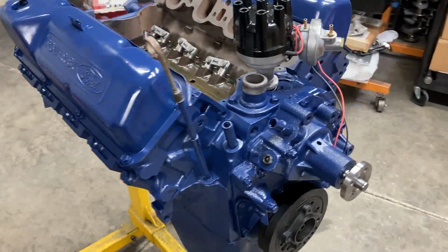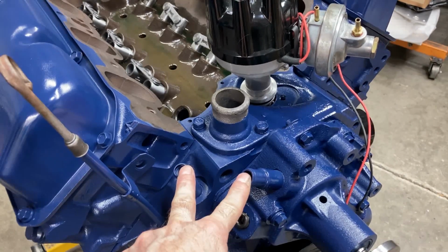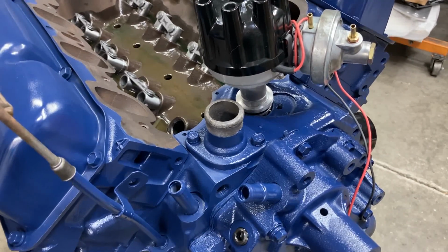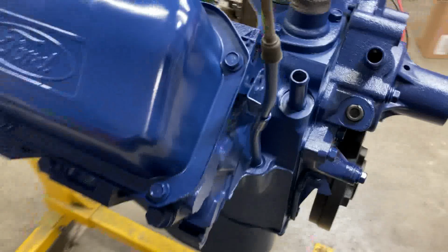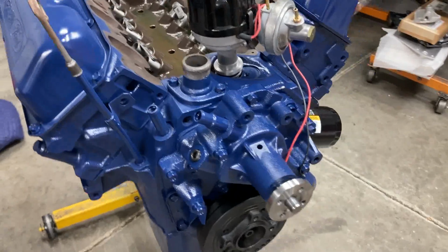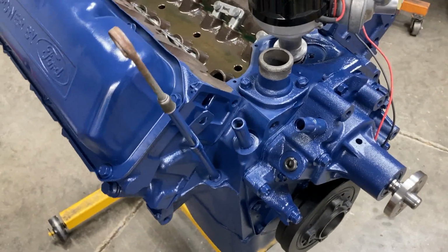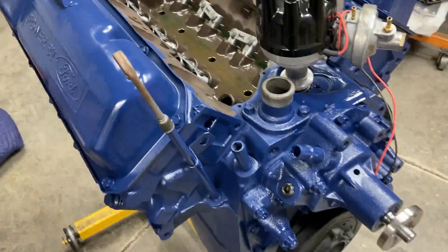And here's where we're going to end up for today. So I'm waiting on a bypass hose that'll fix that. We got our different fittings that go into the block and such. Those won't go in until the intake manifold is on, and I need to touch up a few things. The backside of that dipstick tube I missed, and a few other things, but balancer's on and lifters are in. I even put oil in it and primed it and got good resistance. I didn't check it with the gauge yet, but I'll do that when the push rods and rocker arms go on.